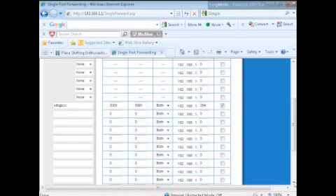If you want to watch your Slingbox from outside of your home — which most people want to do — you'll need to access your home router settings and open up port 5001 to your Slingbox, which in our case was at IP address 192.168.1.254. Opening this port allows you to access your Slingbox from outside of your home network.